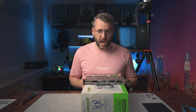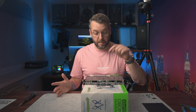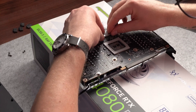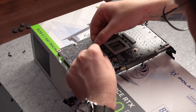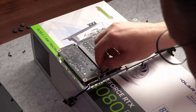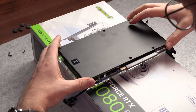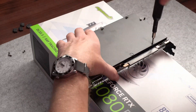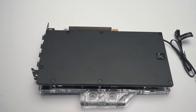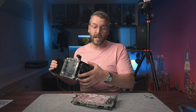The hardest part is now behind me, so all that's left is applying the thermal pads on the backside of the PCB. Unlike some other water cooling companies, Alphacool luckily includes pretty solid backplates with their water blocks — and they're not just for decoration. Thermal pads on the back of the PCB actually help remove heat from hot components quite significantly. This particular water block also comes with an LED strip, but I will likely not use it because this GPU will end up in a rack mount case, and rack mount cases usually don't come with glass panels — well, at least mine didn't.